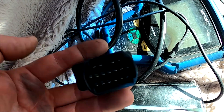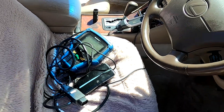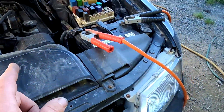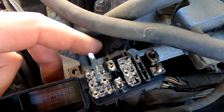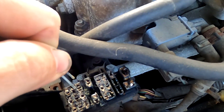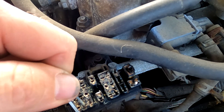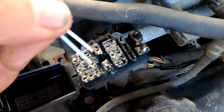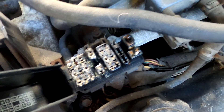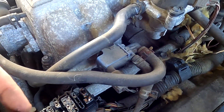There's the correct plug that does plug in. People tell me OBD1 you can't get a scan tool - that's crap, you definitely can. If you ever get a mechanic and they come out and try to plug into this one, just have a real quick look - VF1. Here's VF1 for check engine - it's not present. So the scan tool won't read that VF1. If it does ever connect, you're going to get the wrong data. On most models, UCF20 absolutely, it'll be scrambled gibberish. So if the mechanic comes out and plugs into this one, question him - because the one inside the cabin is the correct one for the scan tool.